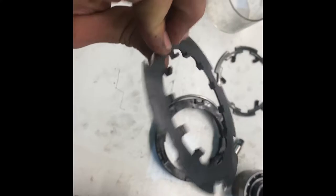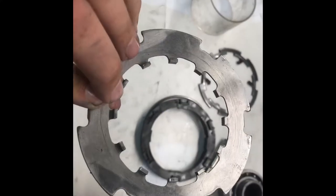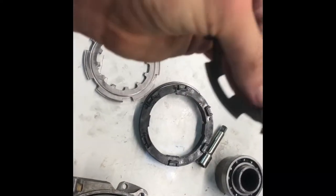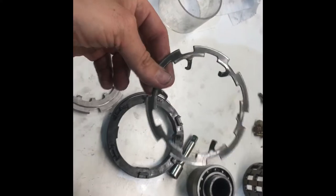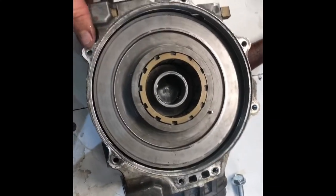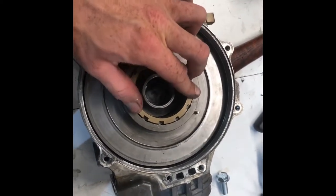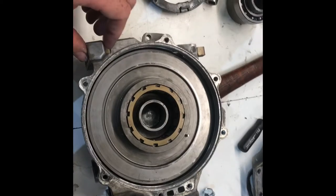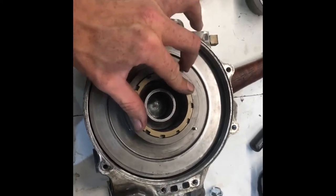Sandcraft makes these plates, and they're all machined out of one piece of metal. With machined teeth, they're a lot stronger versus the older-style thin plates where the tooth is just too long and they bend and break — that's kind of part of it when you stress them hard. Trail rider guys and girls may not ever have to worry about this, but people getting into more extreme racing and hill climbing — this is something you'll probably have to look into at some point. Definitely look into it — they're pretty awesome products, and it's a relatively simple system overall.